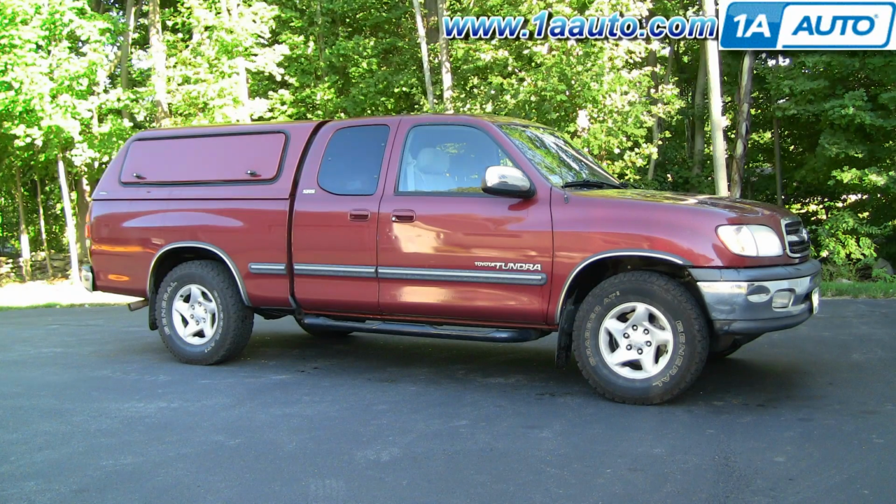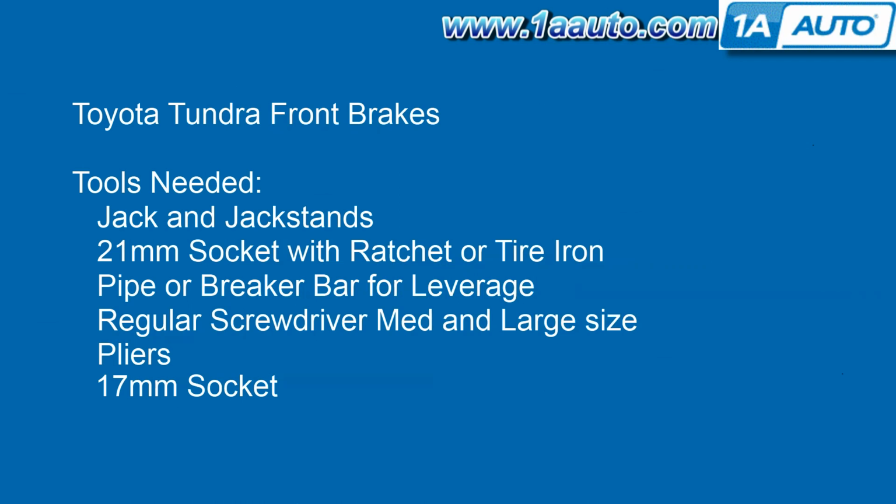In this video, we're going to show you how to take apart and put back together the front brakes on this 2002 Toyota Tundra, same as most trucks of this era. This vehicle actually doesn't need any new brakes, so we don't replace them, but we do just show you how to take them apart and put them back together. Tools you'll need are jack and jack stands, 21mm socket with a ratchet or a tire iron, a pipe or a breaker bar for some leverage, regular screwdriver, medium and large sizes, pliers, and a 17mm socket.